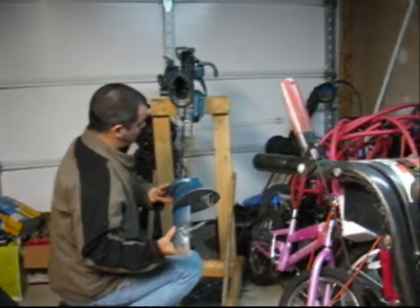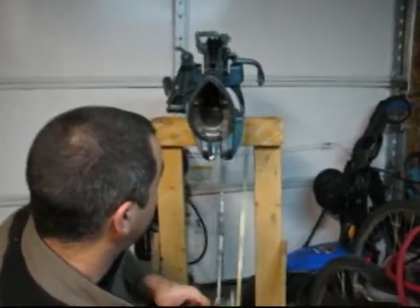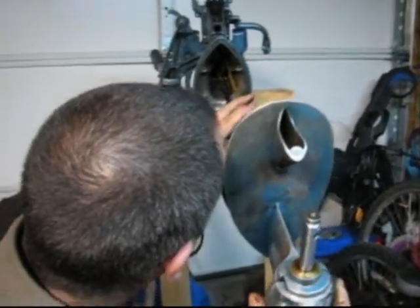So that's how the lower unit would normally come out. You look up inside the lower unit, there's a water tube — it's a copper water tube I'm pointing at. That copper water tube slides into your water pump. And you've got to align your shifter on.